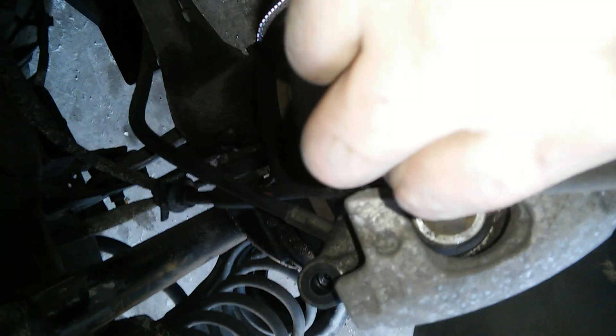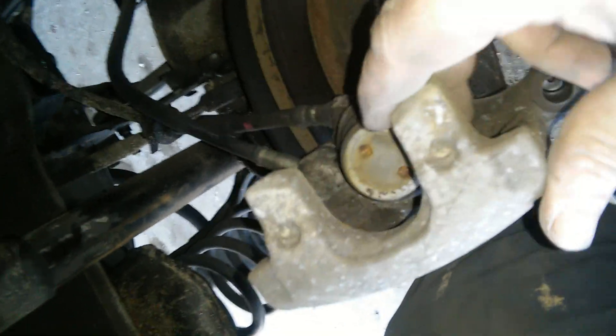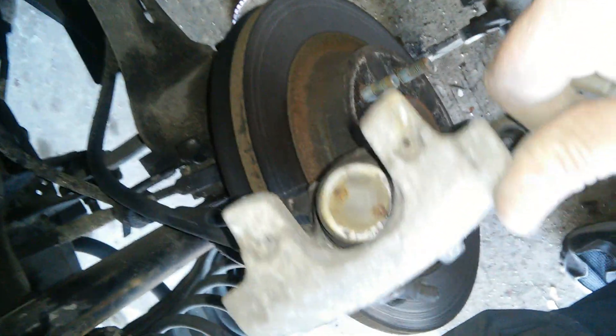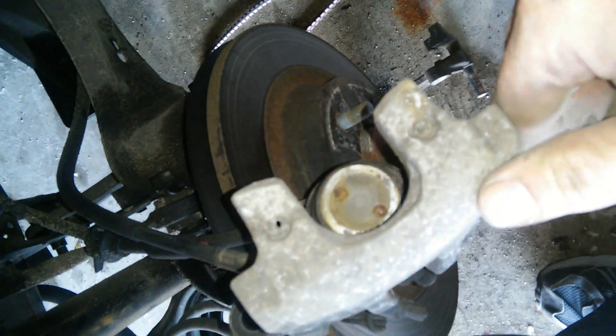The idea is to put your needle nose pliers in here and turn clockwise. But you have to put pressure on it — just turning like this, you don't get any pressure. So I found that I had to wedge the caliper against the hub. I take the rotor off here in just a moment since I've got to change them anyway. And with a pry bar and enough effort and leverage, I was able to get that to compress.